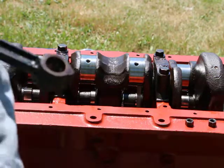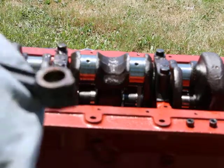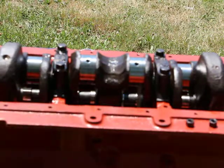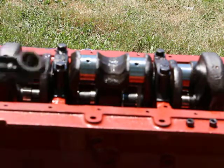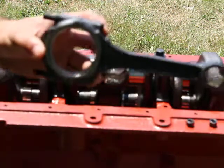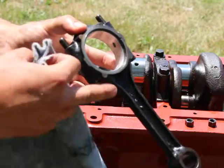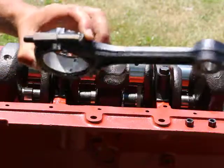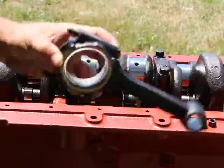In my case, I just have to machine the pistons. You could machine the connecting rods instead, but I'd rather machine the pistons. Or you could just buy a full brand new set of pistons that will fit these connecting rods — but that's going to cost me over $500, so that's out of the question.